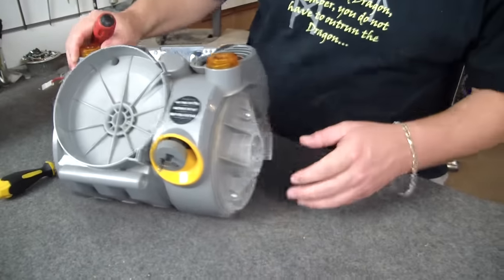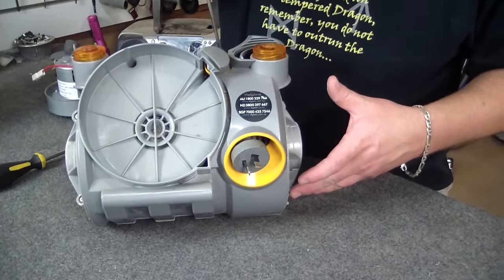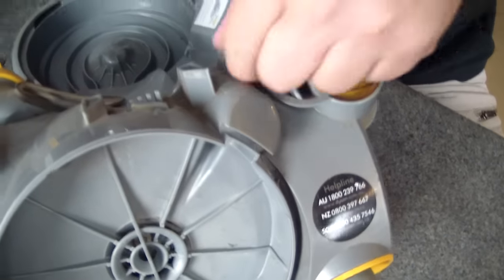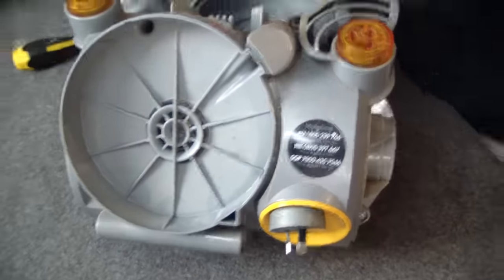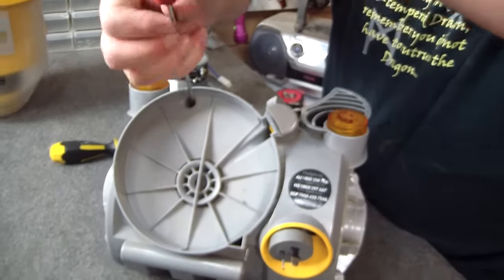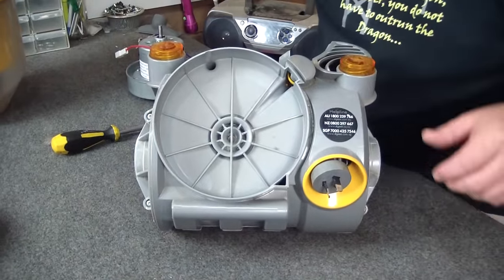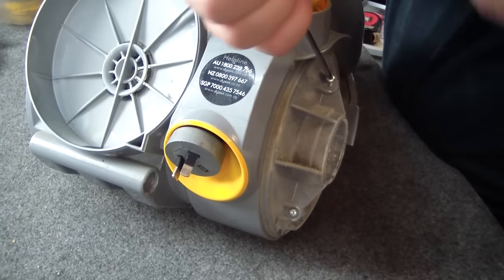From here it's pretty simple — we've got two screws over each wheel arch, one inside there and one here as well. Now, for this screw to be rusty, I'm going to guess this machine is kept somewhere near the laundry. Builders normally put a linen cupboard there, but if you can avoid it, it's ideal. I've seen plenty of machines ruined over the years by that extra exposure to moisture.